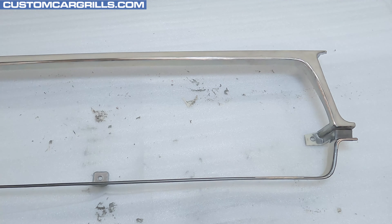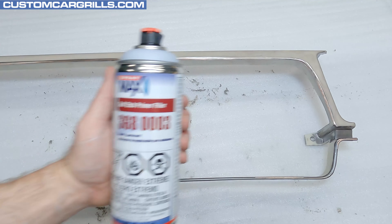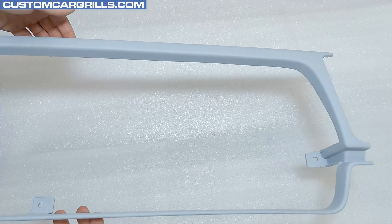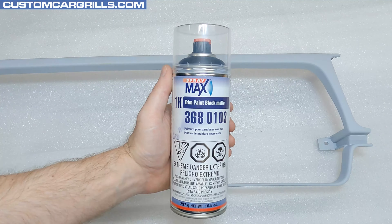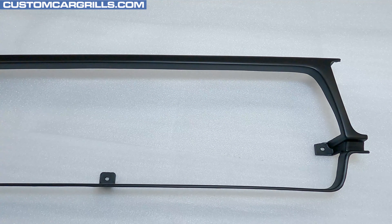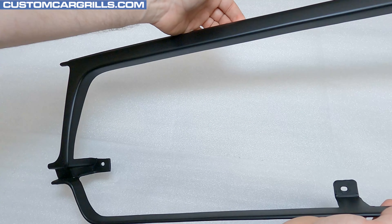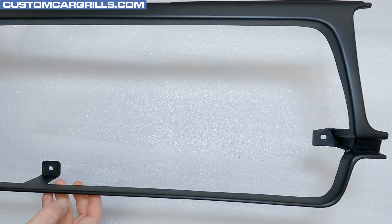Masking off the front and painting the inner edge gray or black would be the next step if you wanted to keep the chrome front edge. To color swap it to black, I went ahead and stripped off as much of the chrome as I could from the whole grille — it's hard to get into all of the spots, but this is mostly stripped to my liking. To start the paint job, I'll primer it up using the SprayMax 1K self-etch primer filler. This goes on very evenly and dries quickly, and mine looks really good — I don't think any additional sanding or repair is needed. Next up, I'll grab some SprayMax 1K trim paint in matte black and apply a couple coats. The cut edge looks really clean and this new black paint job is super sleek.